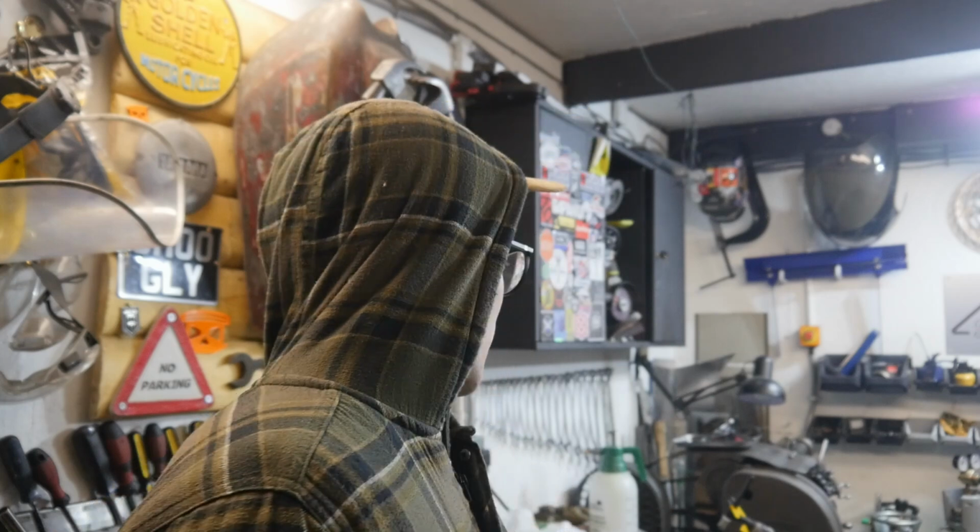Moving forward, I do have now forks on my workbench over here. We got all the parts back eventually, and we got them built up by Sean over in Fife. I'm going to get his company name wrong, GSG Suspension, something like that. I'll correct it if I've got that wrong. Built up with new K-Tech internals. I remember I maybe mentioned that because of the weight of the VMAX compared to the R1 that the forks were originally from, I had to get suspension upgrades inside to cope with the weight of the VMAX. So that's all been done.